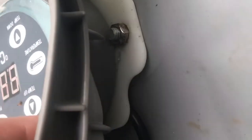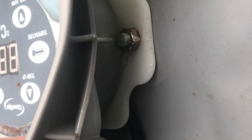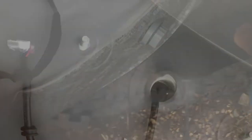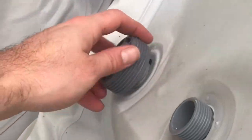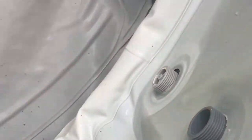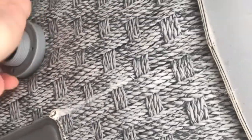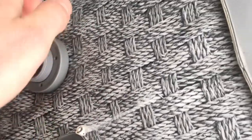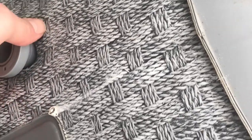The first thing you're going to want to do is remove the control panel. You do this by folding up the flexible plastic and unscrewing the two nuts on either side. The back of the control panel is held on by some screws — undo these so you can take the cable out. You then need to unscrew the two fittings on the inside and the one on the outside. Some of these are quite tight so you might need to use a tool — just be careful not to damage the threads. The unit will then slide out; it's a bit tight so give it a good pull.